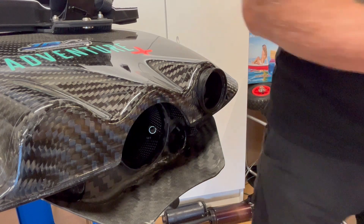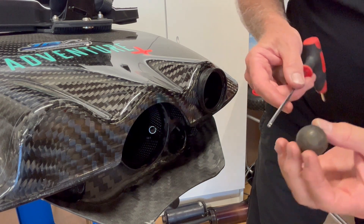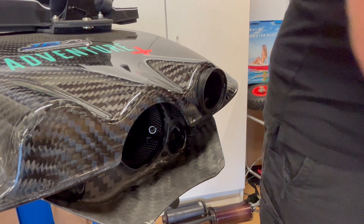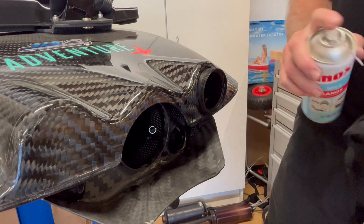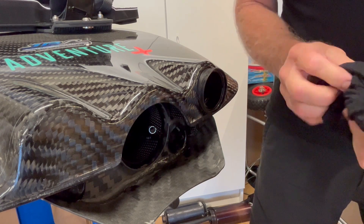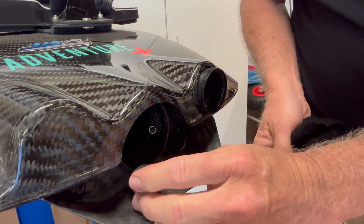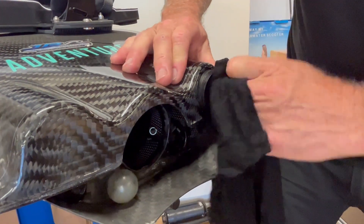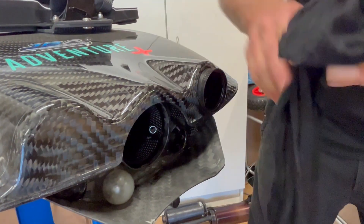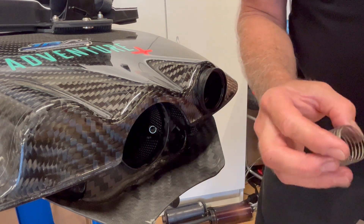Unscrew the little end cap and the assembly comes apart. You've got your spring that sits in that little collar, your eccentric ring, your threaded ring, and inside is the ball. This one's not too bad — you can see where it's been seating on the seal, which is good, and the seal inside looks like it's in good condition. I'll give this one a quick clean using my Lanox spray — give the ball a bit of a spray, clean off the ball, and clean out around the seal to remove any extra carbon and buildup.